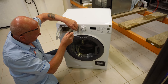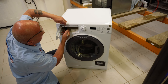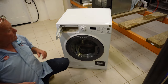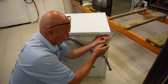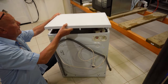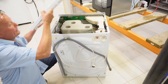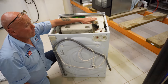At the top here you have two screws - remove these. Remember all this work should be done with the appliance disconnected from the electricity supply. These screws normally need a little tap to get them out because they're in an insert. Now we need to take the lid off the machine. On a lot of these welded cabinet machines the lid sometimes slides backwards, sometimes you have to lift it up and slide it off.